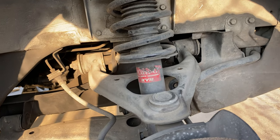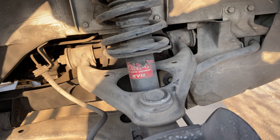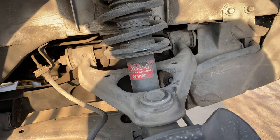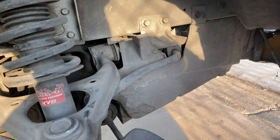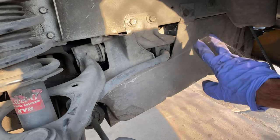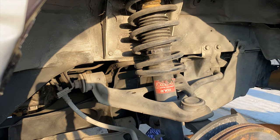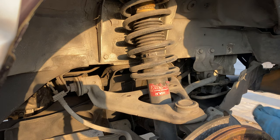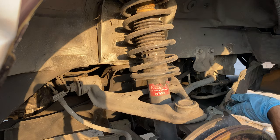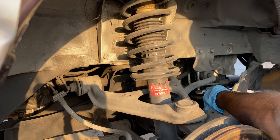Okay, this is the hard part. To make this easy we're gonna have to do something hard - taking off this long bolt right here connecting the upper control arm. It's held on by a 21 on each side and it is a beast to take out. We're gonna have to loosen up this bolt in the back connecting the sway bar - we'll loosen it, take off all this plastic to move it out of the way. The sway bar bolt is held on by a 12.